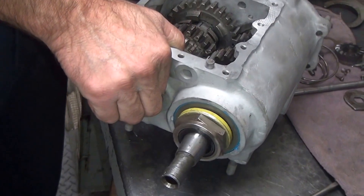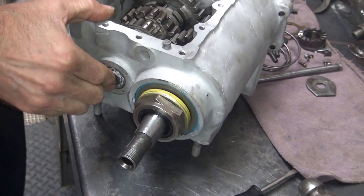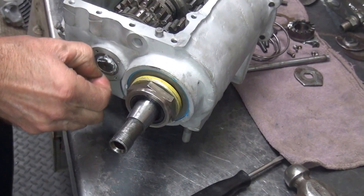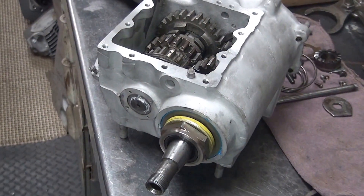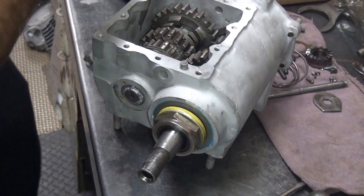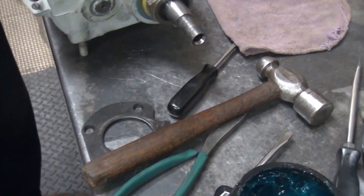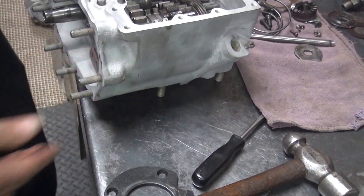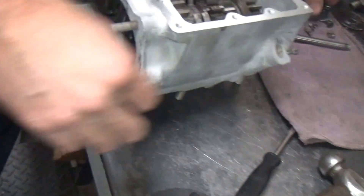It ain't going — you just go boop and that's it. And there'll be a nice piece of rubber we didn't need. See the rubber we didn't need? Yep, shaved it off. That's what they make goop for. This one doesn't matter because it has a cover over it — a secondary seal. See, the old bikes didn't have that o-ring at all, that's new stuff. You could actually run it without the cover if the o-ring worked, but in this case the o-ring didn't work too good — but that's normal, that's why we have all the goop on it.